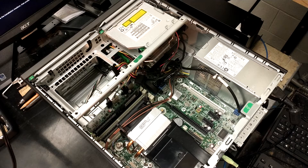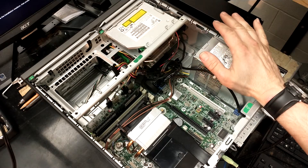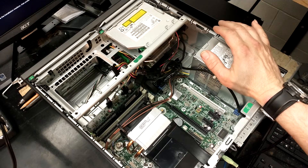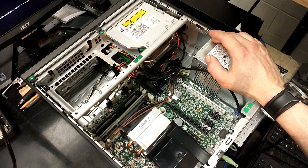The next thing you're going to need is a computer. You need a 64-bit processor and two, four, or eight gigs of RAM — it's not really that crucial. This computer came out of the recycle pile, basically free, and it's going to do the job. A laptop will work too. But the key thing you must remember: if you have a hard drive installed in the machine you're going to use, you must disconnect the hard drive.